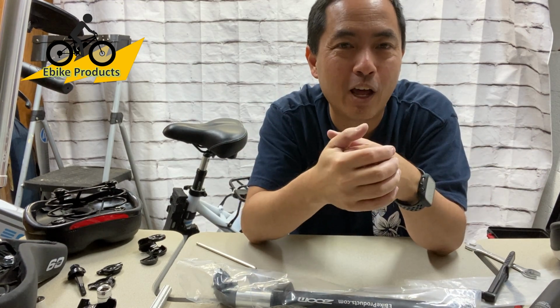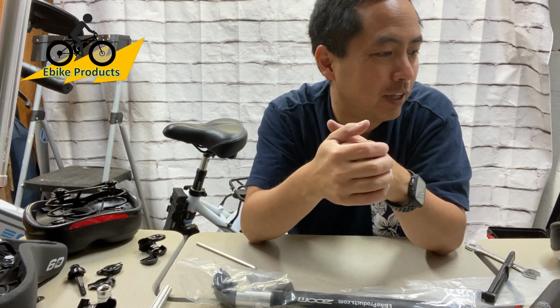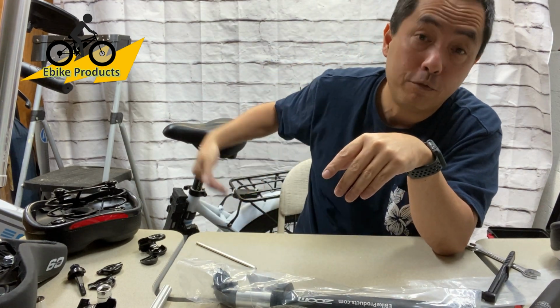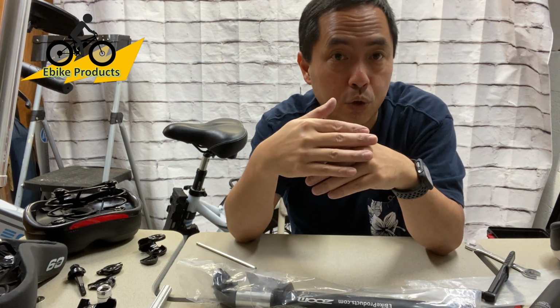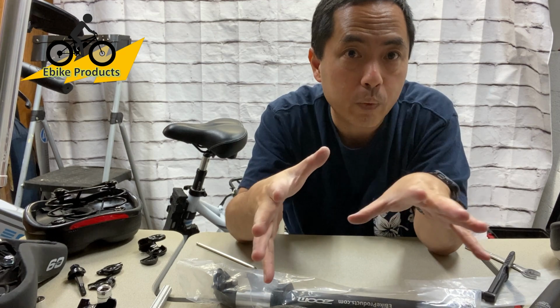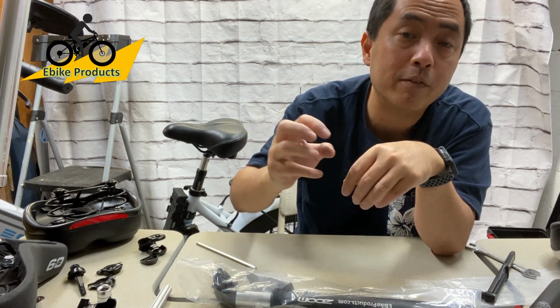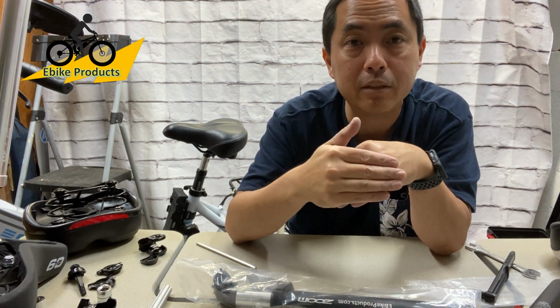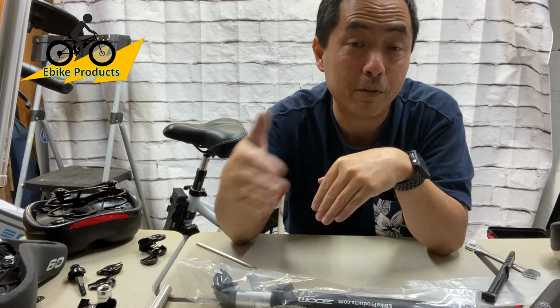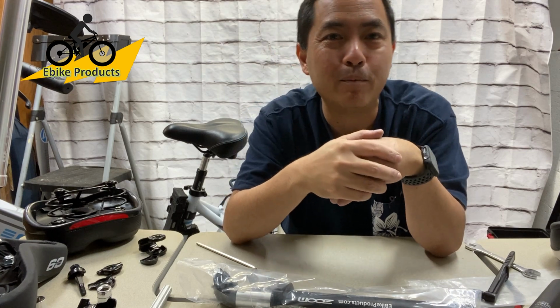I've been able to get a lot more rides out there. Yesterday I did a speed test on the bike, because I'm going to be changing out my freewheel from the 14 tooth to the 11 tooth, to show how much extra speed I can get out of it. But more so, if you're not aware of this, changing the 14 to 11 on the highest gear also helps extend battery life. I'll explain a little bit more about that in the next video when that video starts to come out, and I've got to make sure I have enough time to go through that.